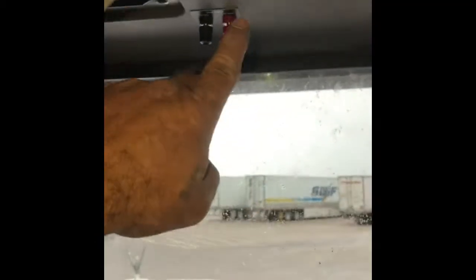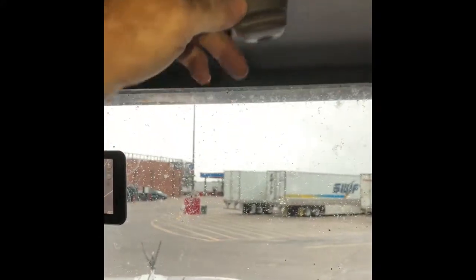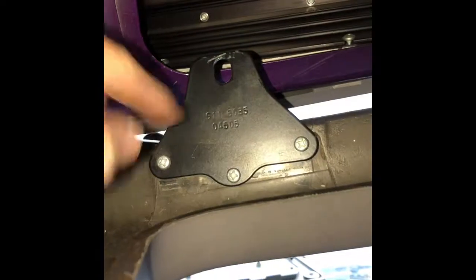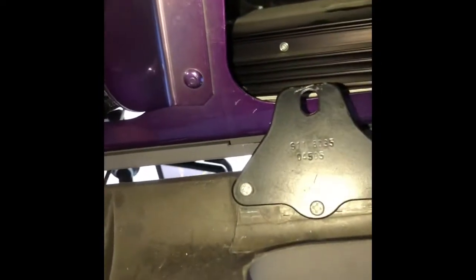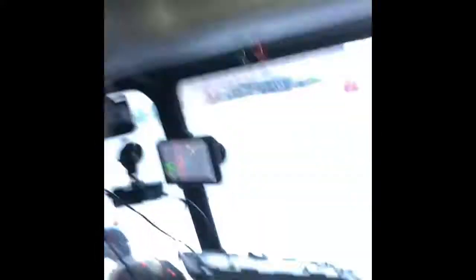See this plate right here — I'll explain that in just a minute. That's actually what holds the other end of your visor up, your little visor clips. One screw takes that out and makes it so you can remove that bracket, where it'll stay on the front cover and you pop it out. I didn't know that, and you can't see up in there well enough to tell, and as far back as it sits, I didn't think it was attached to the front cover of the overhead console — but it is.